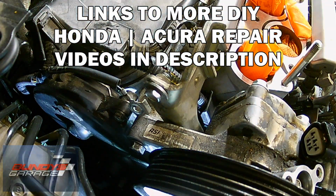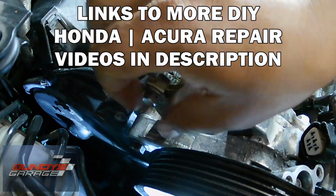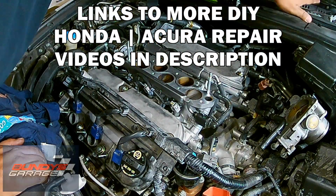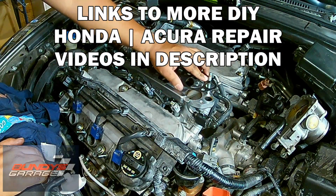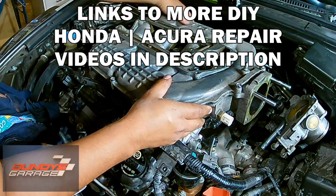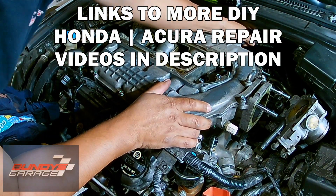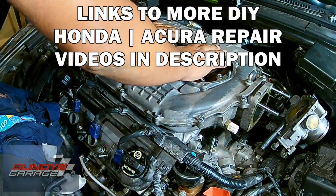So just tightening everything up right there. The last power steering bolt on the back. And then the ground wire right there as well. Okay, so I pull all my old gloves out and rags and everything else, and just putting the upper intake manifold gasket on. Putting the upper intake manifold on. Then it has bolts and nuts that you put down into place.